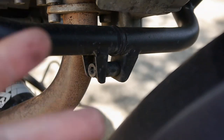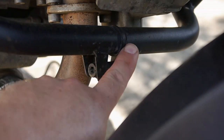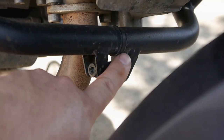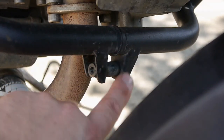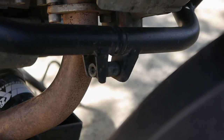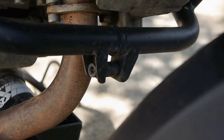So two options. One, we could tighten this up more and see if it's just loose — as we tighten it, it should put pressure on this and we should be good. But if these are already bottomed out, then it shouldn't tighten much and we're still going to have rattling. At about 5,000 RPM this thing just starts rattling terribly.